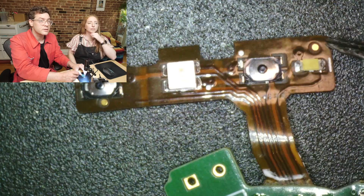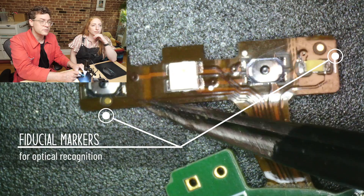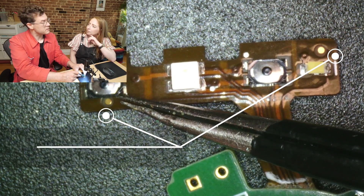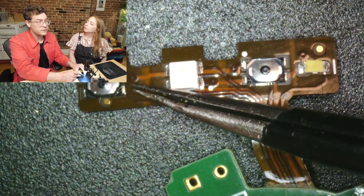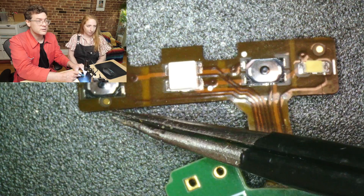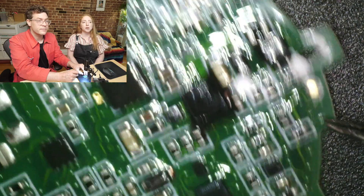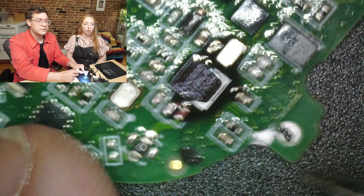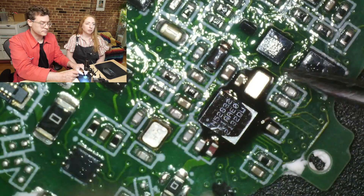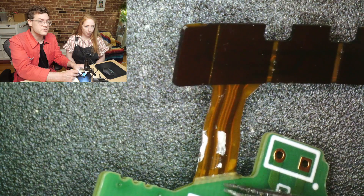Here and here, these are what are called fiducial markers. During automated circuit assembly processes, there's often a camera that figures out the orientation of the PCB so it knows how to calibrate the pick and place. I saw them on this board too. I've seen them on other boards and always assumed they were test points for a pogo pin jig. But that makes sense — for optical alignment. Also, you can see it's actually a rigid-flex board because the flex is going straight into it.